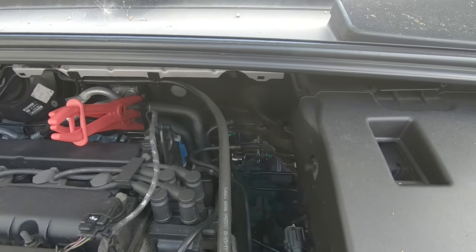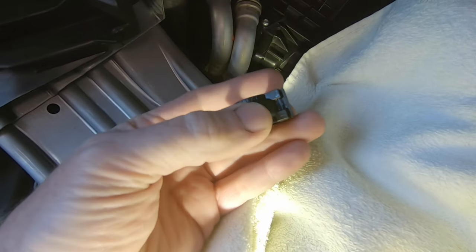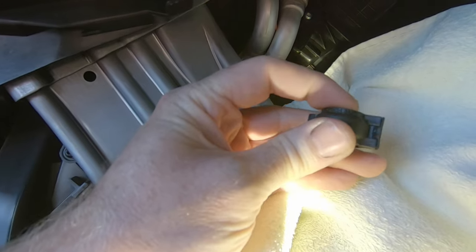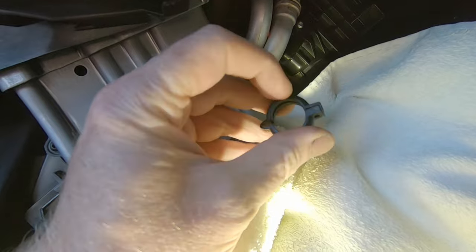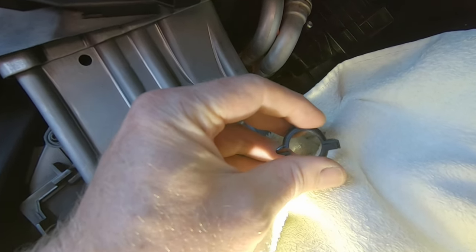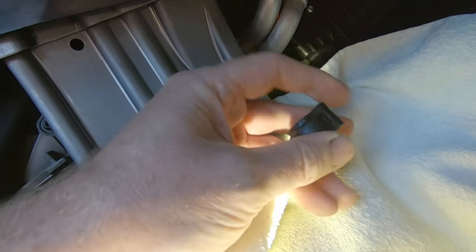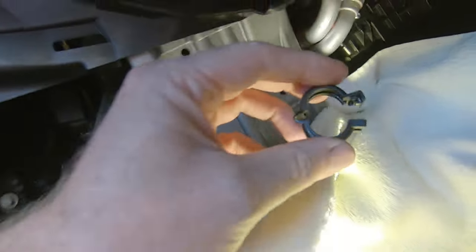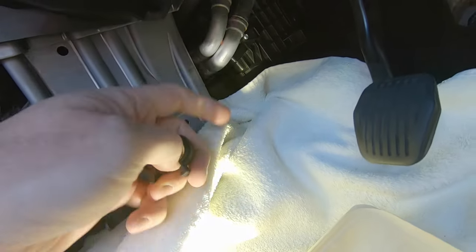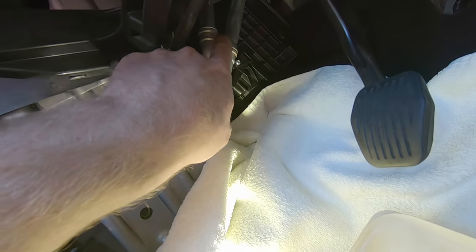I don't think you can really move them that far through the bulkhead anyway - just move them the minimum you can. I've already popped my clamps off, so these are the clamps that are on there. If you look at the back of them there'll be one part that looks like that, and you stick a little screwdriver in there and flick this overlapping section - there's a section that overlaps it - so you flick that out and then they just pop open. They really did pop open without any effort at all, so there wasn't much tension on either of these. The top one was spinning quite loosely as well and when I twiddled it today it was leaking.